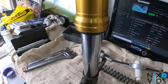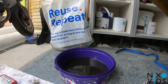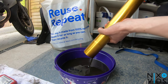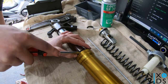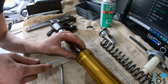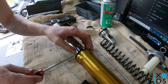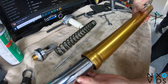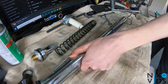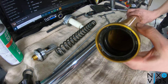Now you need to remove the spring and then pull the fork out from the outer cylinder. Make sure you've removed all of the last bits of fluid from the fork — there shouldn't be much left in there. Place a flathead between the fork seal and the outer fork tube and prise it apart slowly, removing the fork seal from the fork. Slide the outer fork tube all the way up and it should come off, leaving the actual fork seal rather than the dust seal inside.